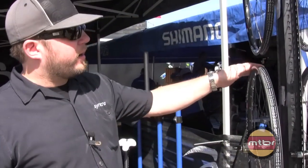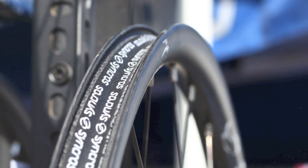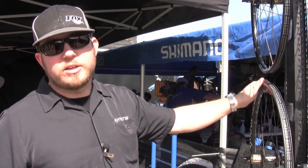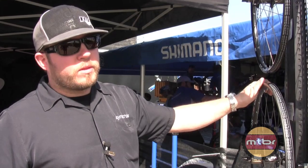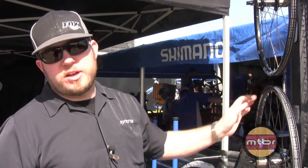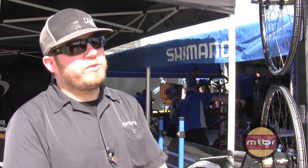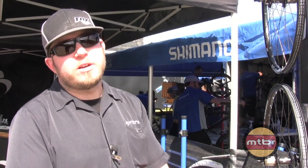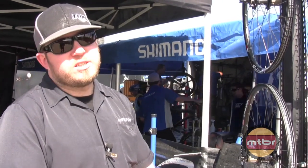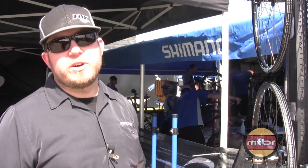The next feature is the monocoque construction rim. As I mentioned, it's 25mm wide, 20.5mm on the inside. The rim alone tips the scales at about 310 grams. Since it is monocoque construction, we're able to make the rim extremely stiff — about 14-15% stiffer than many other carbon rims on the market. It also shares technology with Ritchie rims, such as no air bladder left inside after production, making it very lightweight.